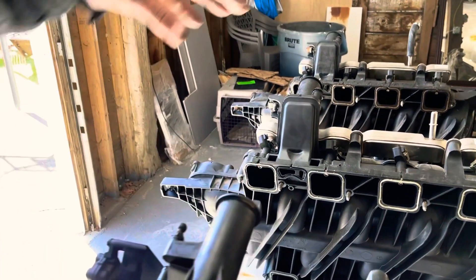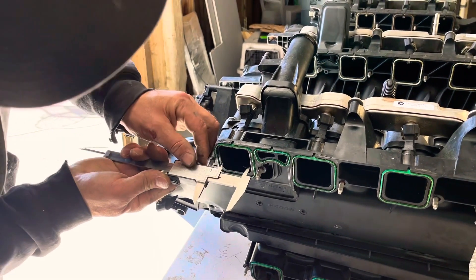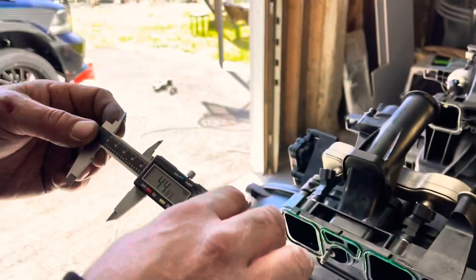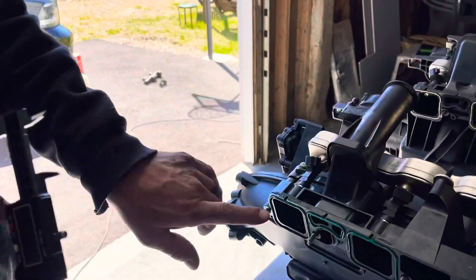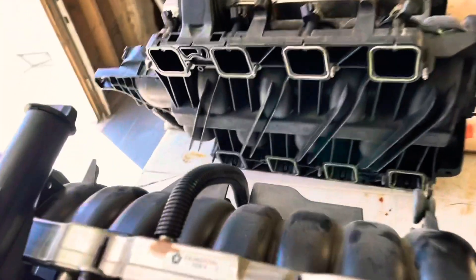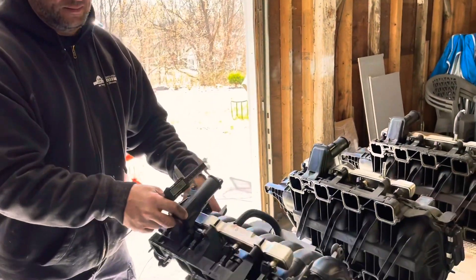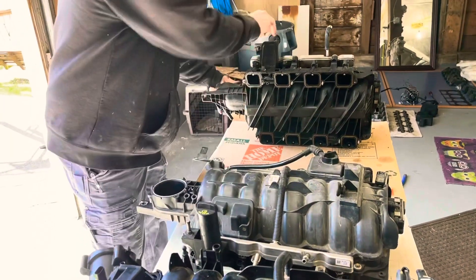It's just the mouth of the opening that gets ported — they don't port the hole inside. But it helps. And here's the 6.4, which is 45 by 45 — kind of in the middle. This isn't ported yet, but the internals and chambers in this are bigger, obviously. So once this is ported, it'll be even more. These are your differences on the millimeter size between the 5.7 stock, 5.7 ported, and the 6.4 stock. Once I port this, maybe I'll do another video on that as well.